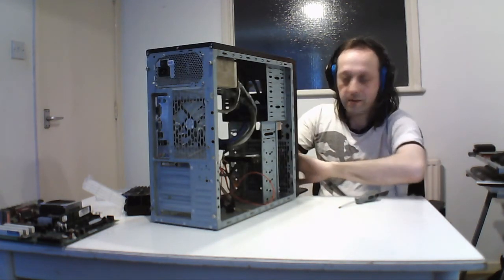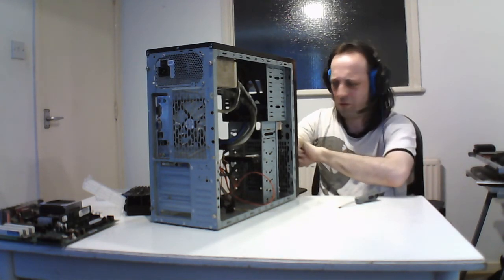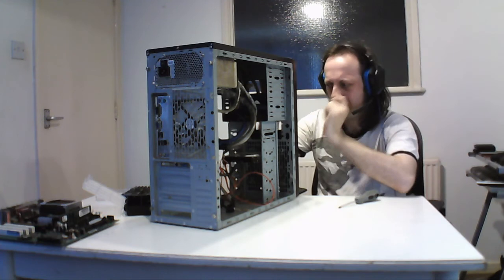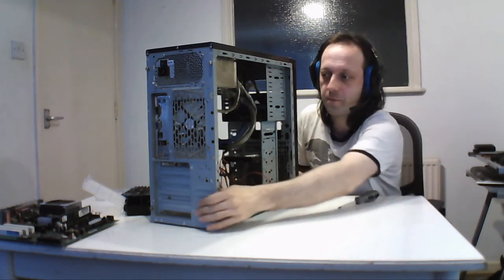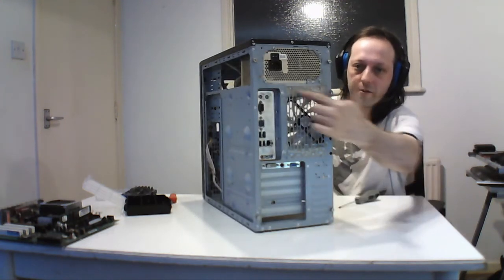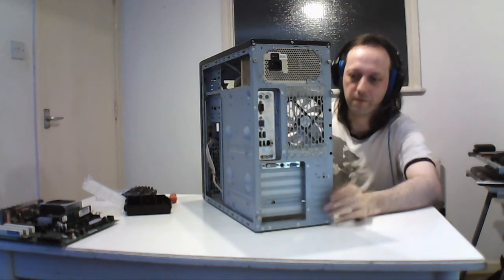The front was difficult to put in, and the thing with this case is it had 4 positions for an 80 or a 120. So it really was an odd case. There's a buzzer on here as well. That's another handy thing to have. But what I had to do with this, I had to take 2 parts of this up to close the 2 air gaps because that mattered for the fan.